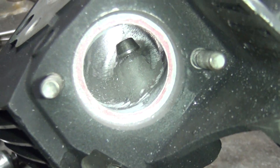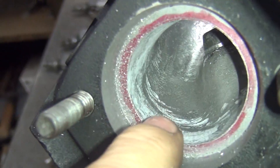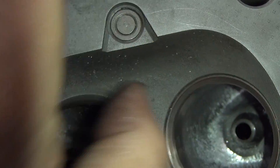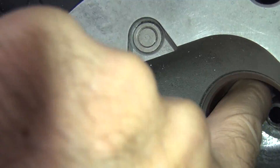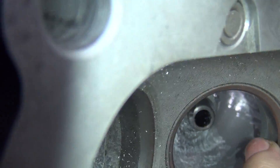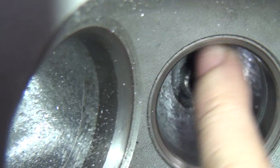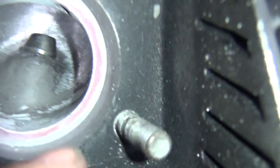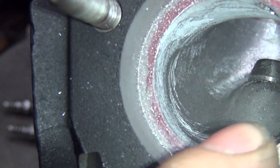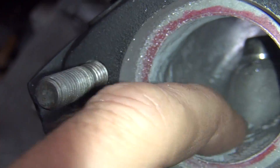We're just about done with this exhaust port now. You can see the spots I haven't ground and the spots I have ground. We just take off the high spots — the stuff we don't like — so we make a nice even transitional radius all through here, all through the bowl, open up the bowl for better breathing. Clean up the short side back here, radius it in really nice and clean. Bring it out to our bigger valve size, and you can see the low spots — we don't cut those. Now I'll just do some final semi-polishing with my finer stone and leave it at that.